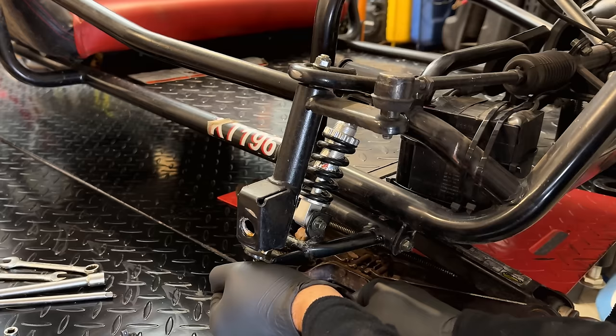Let's check it on the exhaust. It should fit on the exhaust. And it's actually pretty tight. All right, let's see where we're at on the intake. We'll start with a 4 thousandths. It seems like we're less than a 4. Let's check the exhaust. 4 fits. Oop, we got 2 there. A 5 feels pretty good. Let's check a 6. And I'd say it's not a 6. It's closer to a 5.